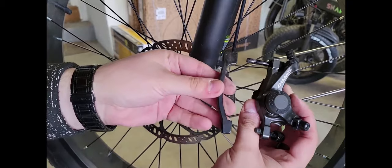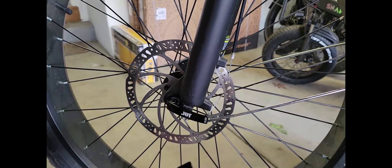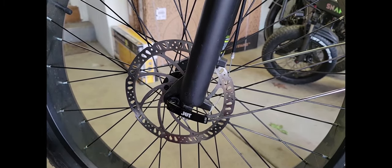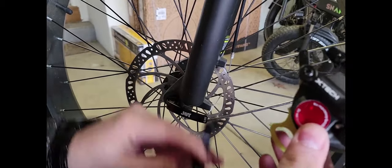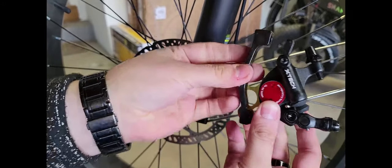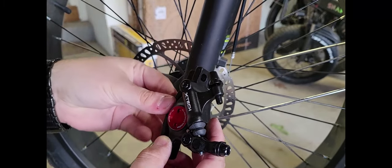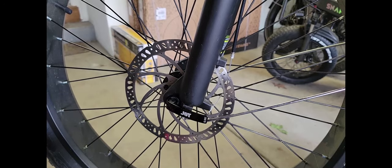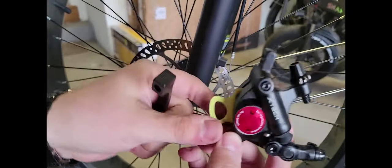We're just gonna pop the hydraulic caliper on there. Be sure not to lose any of the washers or spacers that are on the old bolts. It's even labeled on it — it says 'this is up' so you know which way it goes. The washers are already on the bolts from before, so we're using the same bolts. Once we're ready to put it on, take out the little spacer and it'll go right over the disc.